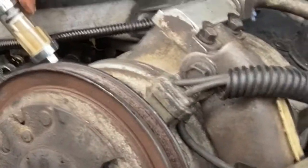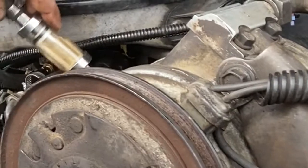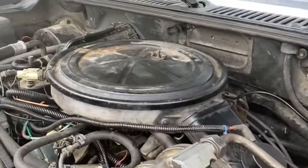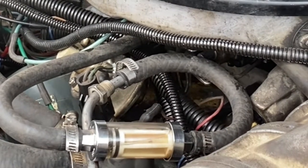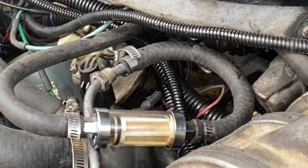However, this clear filter is half-full. I can get air bubbles out of it, and I can fill this back up just like that — and look at the air bubbles just going right back into it. Somewhere in my fuel system, I am sucking air into it. There's a leak somewhere.